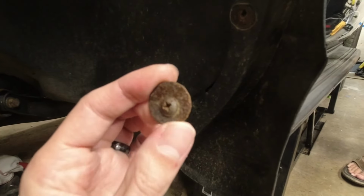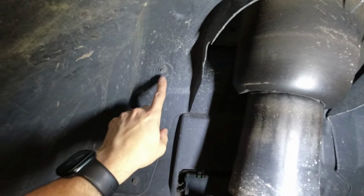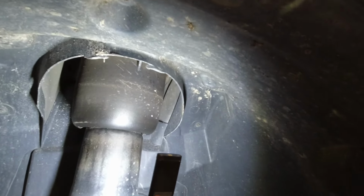All right, so to get the wheel liner out, there's a nut here. There's supposed to be a nut here. I've actually already removed these two bolts, or screws, I guess. In mine, it was one Phillips, for some reason, this is not what it's supposed to be, and one 8mm, which is fine. Some nut here, some screws, one here. And I think that is it. Oh, yes, there are bolts here, here, and here, and here. So this is on pretty secure. Let's take these out, get the wheel liner out, and we'll be right back.